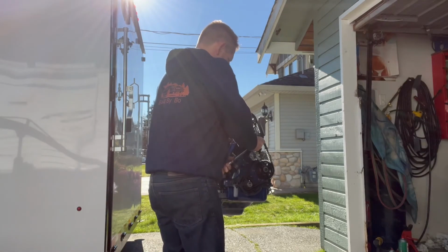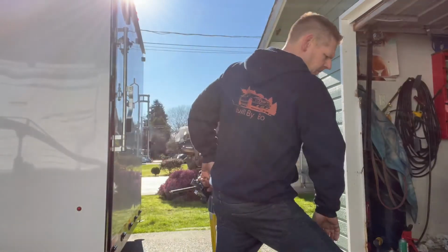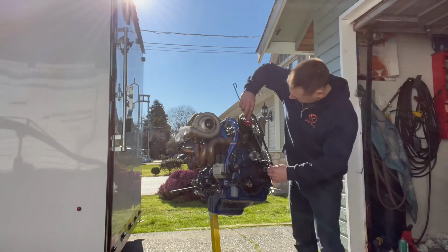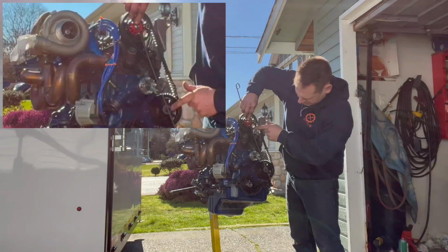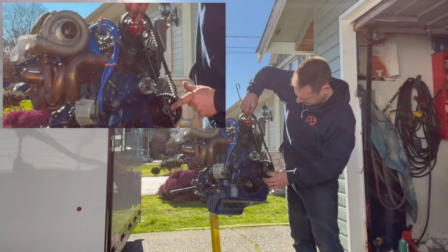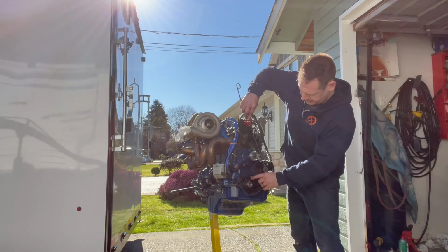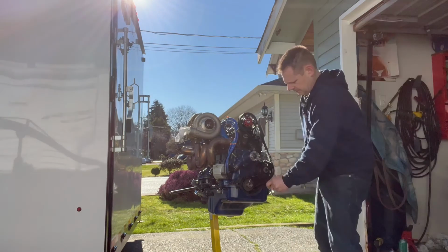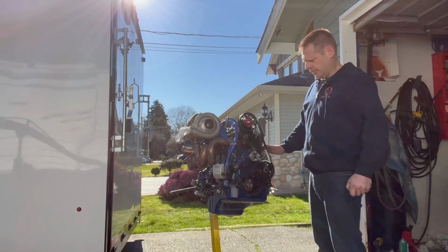And I'm going to tighten up your tensioner. I'm going to recheck it. Down through the center of this bolt, through my notch, to the center of your distributor shaft. And it's bang on. My mark down here is with the notch, it's bang on. So this pulley can be in any place, but you need to make sure that it's actually pointing at number 1 top dead center.